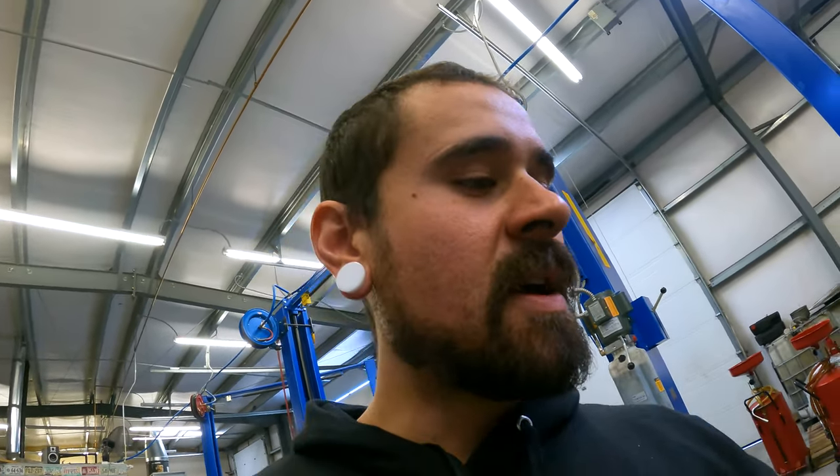Once there's no static left, once it's been wiped down, once it's clean, once it's prepped, hit it with that adhesion promoter, and then make sure you use some kind of sealer before you put base coat on. I know a lot of people make it sound like the sealer part is optional, but on something like a bumper cover, it's not really optional. Always seal your bumper covers because you need it to guarantee that any stray little scratches are all going to get covered up. You also need it for a strong foundation for your paint to stick to. Otherwise, you're going to get rock chips galore. And make sure you throw a little bit extra clear on there for that protection.